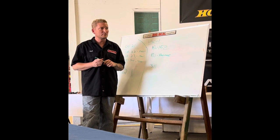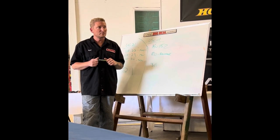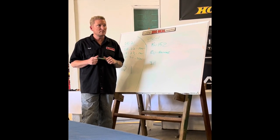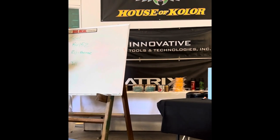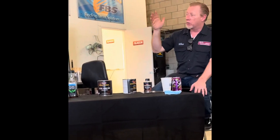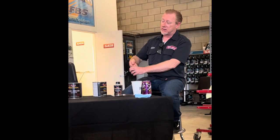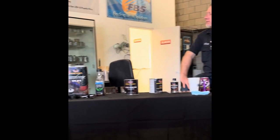But if you're one of those guys, what I see, and I could be wrong, is most people like their primer that they always use, like their clear they always use, because the last thing you want to do is do all this mural work, spray your clear, and then have an issue and start sanding. So if you have time and are really diligent, like John says, set the timer. The USCO one works well. I have a timer on my bench, and I think you need a timer on your bench. Wind up timers. The bell goes off, go in and check it, see if it checks out, and if it's ready, put the next coat on.